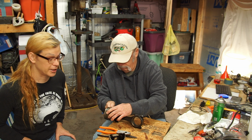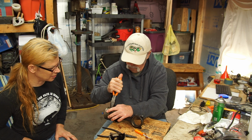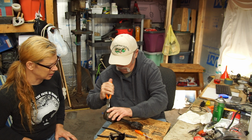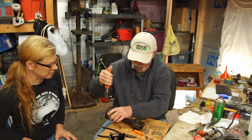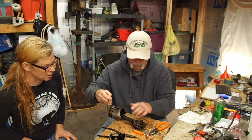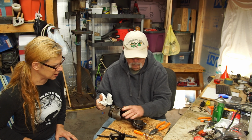So if you're following the channel, this is a piston out of the '66's engine that we took to No Prep Nationals, and that engine is worn out, and it just needs rings. And the oil pan was leaking because of a badly installed gasket. So we are going to reuse these pistons because the bore is not all sloppy. So this is an oil ring. But the rings were whooped, as bad as any set of rings I've ever seen.